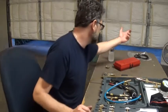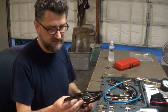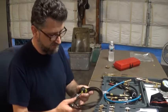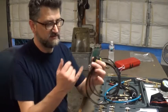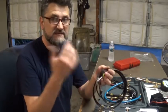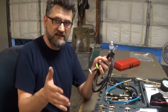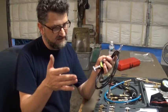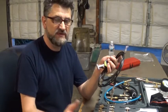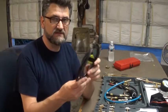I have one more thing to show. This is a little microphone — it's part of fuel delivery testing. We can hook this to a fuel rail and actually listen to the sound that each injector makes. We can sync that with our injector waveform or current ramp. If there's a sound missing from one of the fuel injectors, you're going to see that on the signal. That's pretty cool.